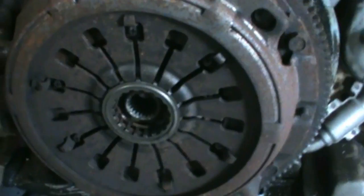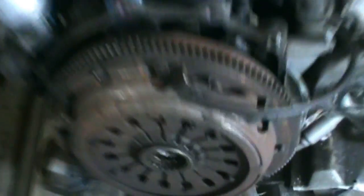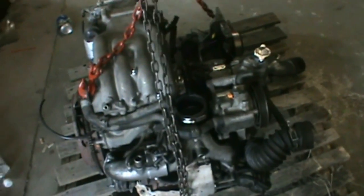So I'll show you what was giving me the trouble. I'm always used to the push style clutches — I had to go in there and push this little ring in so I could get the throwout bearing out of there. This is my first time working on these cars. I knew they had the pull style clutches but I didn't know you had to release them like that. So that's pretty much it for this video. In the next video I'm going to start stripping down all the accessories and getting it all ready to go for the teardown — taking off the turbos and all that. You can see the turbos right there. Anyways, I'll talk to you guys later, thanks for watching.